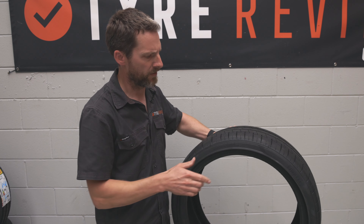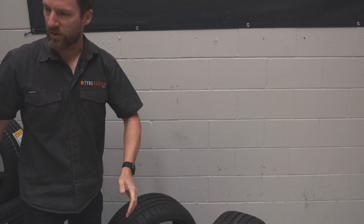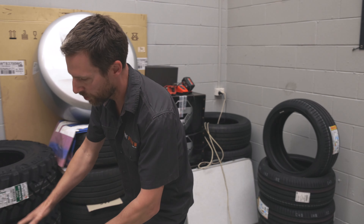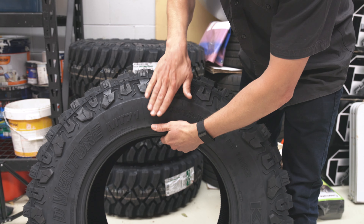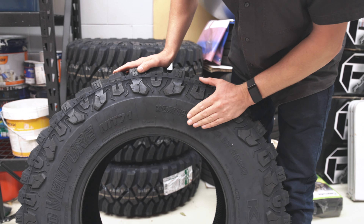Stiffer cornering? We'll roll with that. But if you look at even a bigger tyre like this Kumho Mud Terrain, you can see how big the sidewall is in this, and so there's a whole bunch more rubber in that and hence a whole bunch more weight. So that's sidewalls.